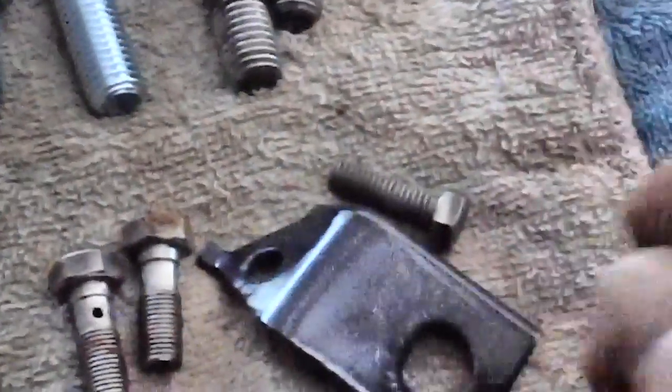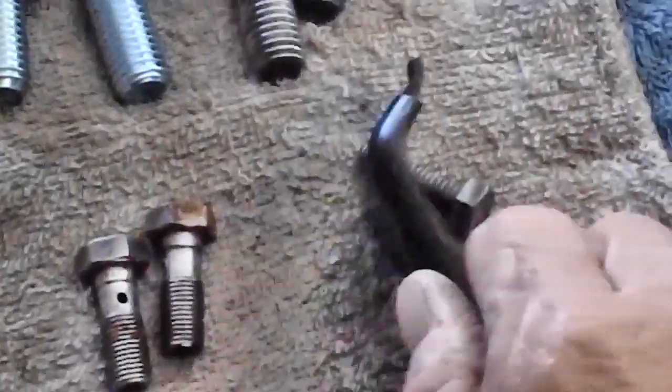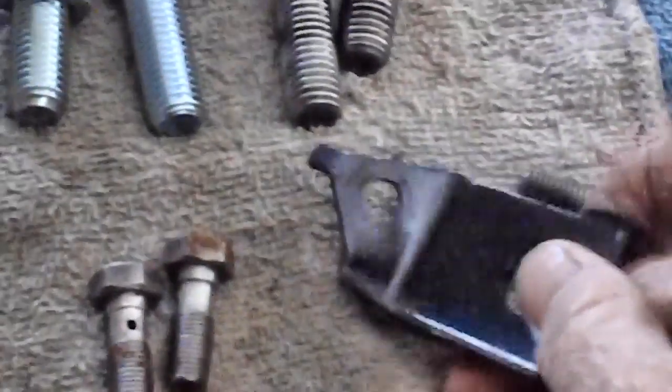Everything's going to be kind of nice here when I get done with it. I have another request of my good subscribers out there who have parts cars. This is the bracket that holds the front bracket that goes underneath the fender and bolts to the body — it holds the flexible brake hose. The brake hose goes through this hole, and there's a lock key that goes on the other side to hold it in place. It was missing on the driver's side — they had used some kind of coat hanger wire wrapped around a bolt head to hold the brake hose up against the body of the car. If anybody has one of these from the driver's side, I'd appreciate it. Let me know, I'll buy it from you and pay for shipping.